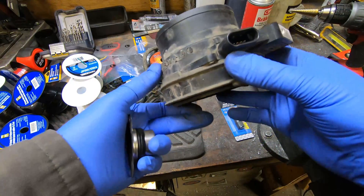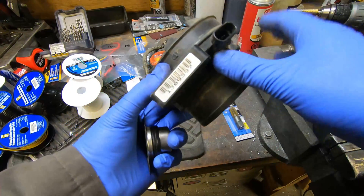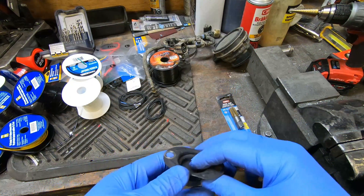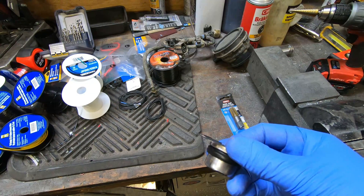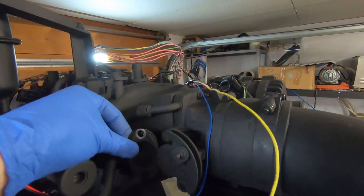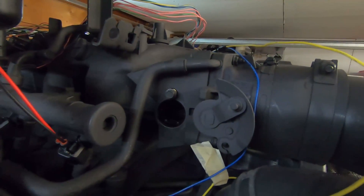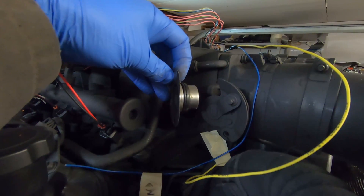The engine donor was a 2003 Chevy Silverado. It used this mass airflow sensor, which I'm not going to use — it has a built-in air temperature sensor, but I'm not doing that. I'll be using just speed density with the Megasquirt. So I want to make a spot to put the air intake temperature sensor in. This MAF housing came off the side of the intake, and you can see that's where it came from and it fits in there. I think this is where I plan on putting the temperature sensor.